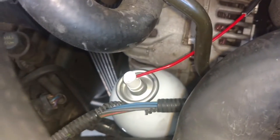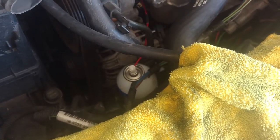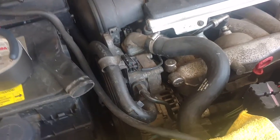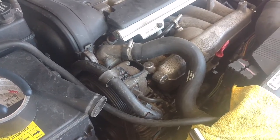I have the tube in the hose. I got the can jammed down there by the alternator, and I'm flushing it every minute. I'm going to flush it five or six times, then hook this tube back up and be done with it. It was tough, but I got that tube back on there. I used my long needle nose to guide it and got it pressed all the way on there. Don't have any kind of clamp on there. So we're going to fire this thing up and drive it a little bit, then do another glove test.